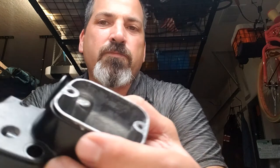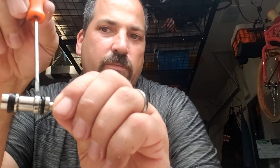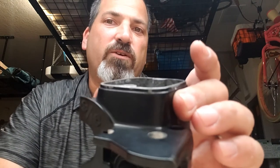They make something called a brake hone that goes inside where the piston goes. It will literally clean it out. If there's a scratch or a burr in there that's sticking just a hair out and cutting and nicking every time you push, you're scraping against it and eventually cutting into the seal. A simple little brake hone — which is almost like sandpaper made for this — run it through and it'll get rid of that burr and make it nice and clean. That means you have to clean out anything in there, because you'll have metal shavings from being honed. Once that's done, clean it with brake cleaner and blow it all out. Use your air — if you have an air compressor, use a blow gun.